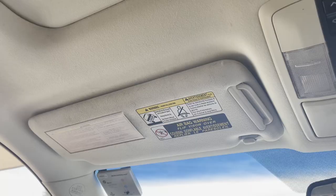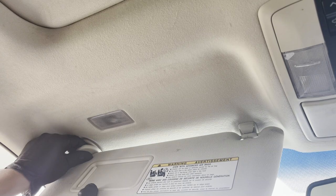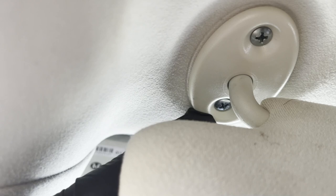To make the job easier, bring the sun visor down in order to remove the base plate — just bring it out through the slit. The base plate assembly is held on with two Phillips screws, one towards the driver and one towards the windshield. Remove both of them.